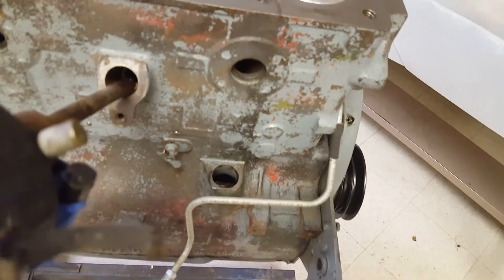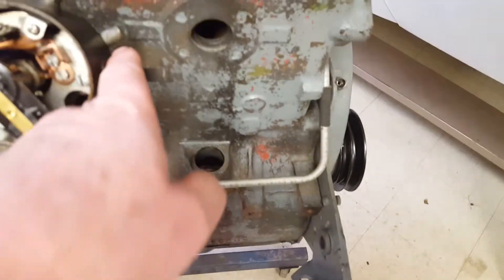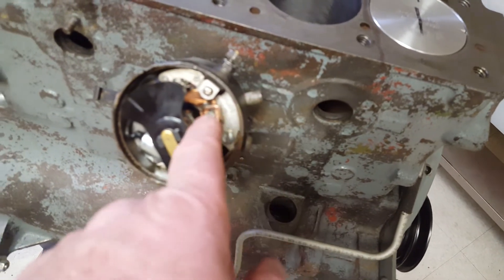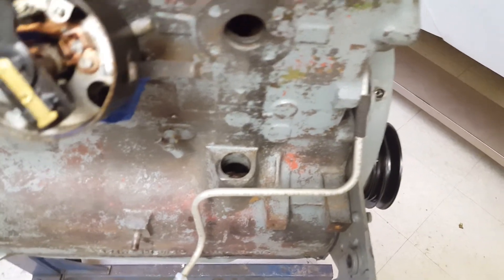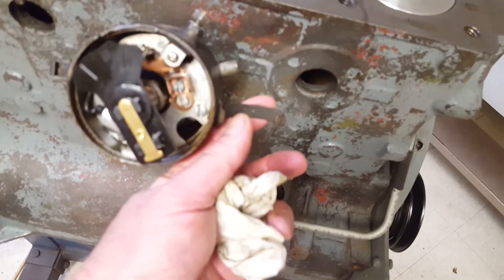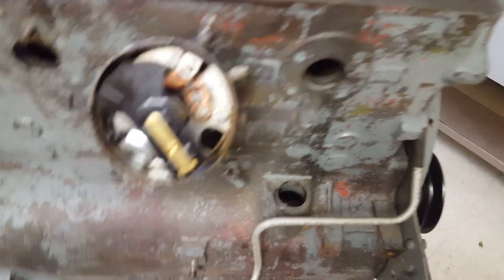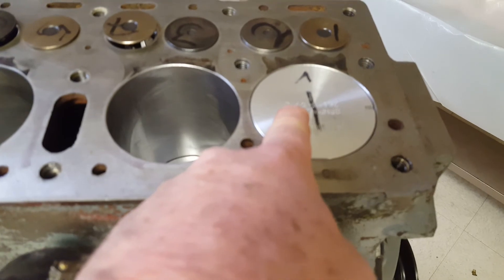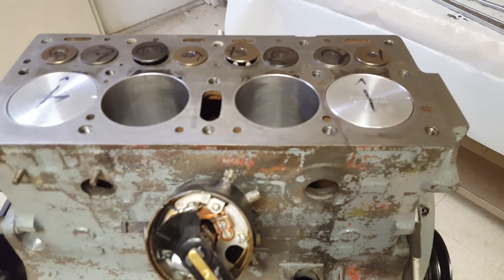Shoving it home at about 11 o'clock — boom, it's in there. That puts your oiler at a slight elevation, which allows the oil to drain by gravity down to oil the distributor shaft. Your clips are kind of horizontal, and again you're at five o'clock, popping the spark on number one — going to the cylinder that's now fully compressed and ready to fire. Shove it down — that's how that goes. Hope that helps you guys.